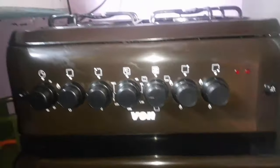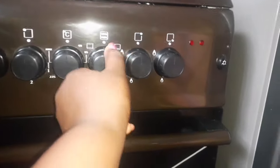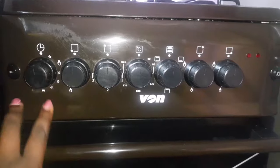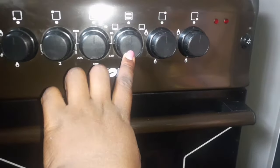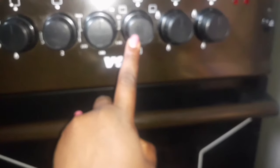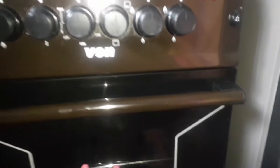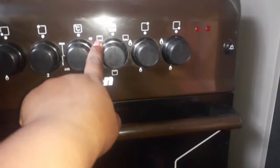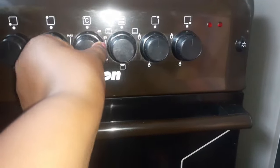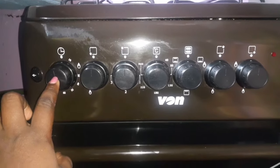After you've turned that on, you come here to your power control switches. You have this one for where the heat is coming from, and then you have temperature and you have the timer. So we are just going to learn how to preheat our oven today and nothing else. The first thing you do is choose where your power is coming from. When you're preheating your oven, before you cook, before you do anything in the oven, make sure you preheat because that will enable the food to cook faster and evenly. So we are going to choose the heat to come from both top and bottom. You turn your button like that. Temperature should be 180 for most foods that you're baking, mostly cakes. For vegetables, you must put higher than that. And then the last button will be the timer.